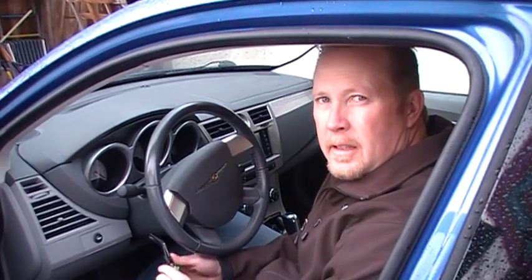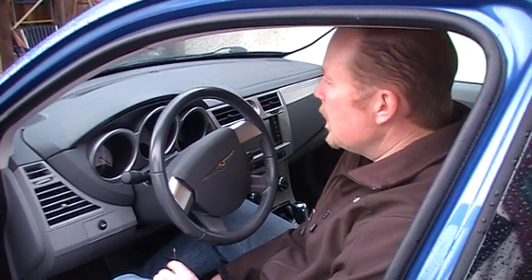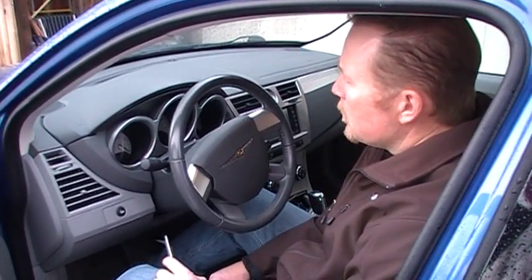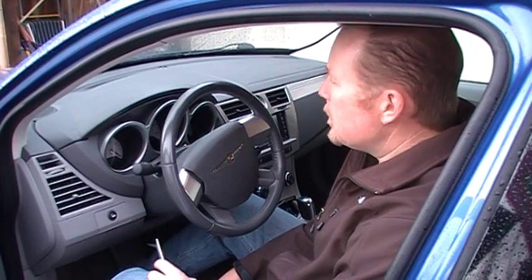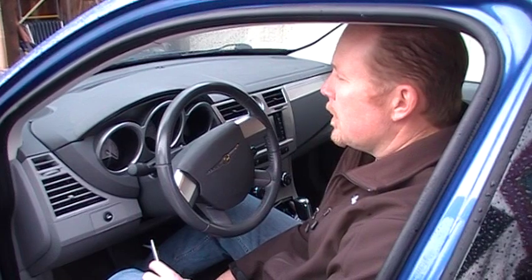This video is brought to you by ClusterFix. Today we're going to demonstrate the removal of an instrument cluster for a 2008 Chrysler Sebring, similar to 2009 and some of the later year Sebrings. A lot of the Chrysler vehicles in those years have problems with the electroluminescent lighting, so you won't have any backlighting on your cluster to see your gauges at night. That's one of the services we perform — a heavy duty upgrade service — to prevent the illumination from failing again in the future, since it was a faulty design from the factory.